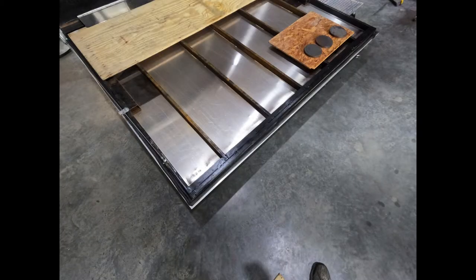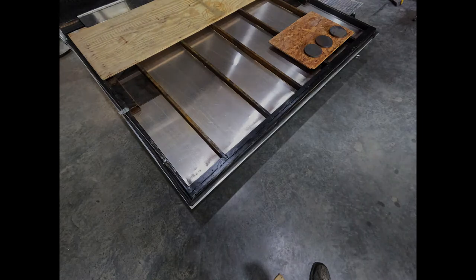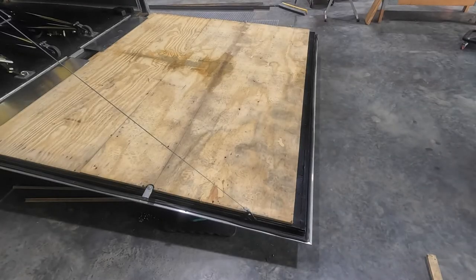At this point we've accomplished a couple things. We've increased the width of the area at the back of the door so we'll have a better place to mount our ramp track. Also the track will be dropped down three quarters of an inch — the thickness of our plywood — which will reduce the height of the speed bump. Okay, now you're all up to speed. Let's get on to some construction video.